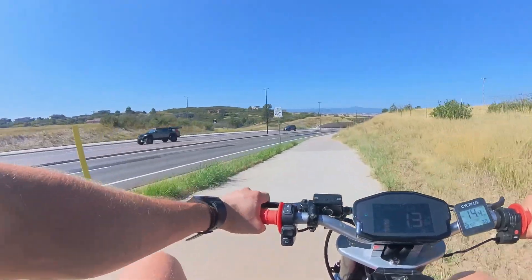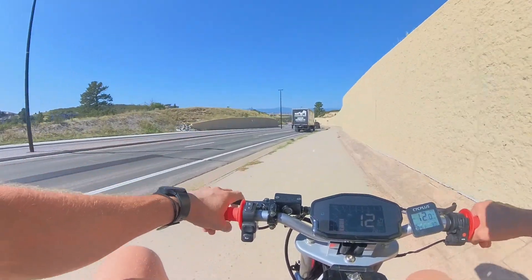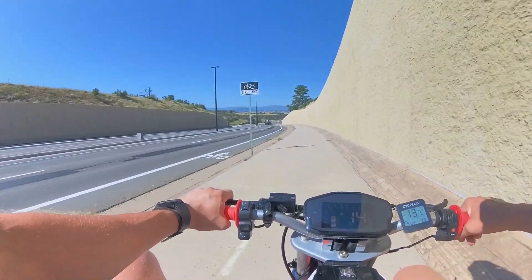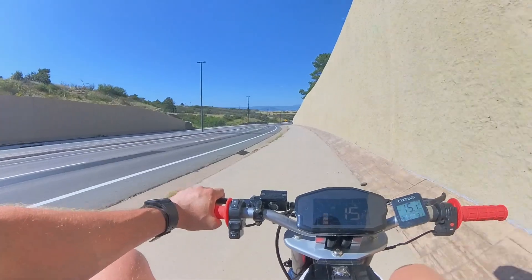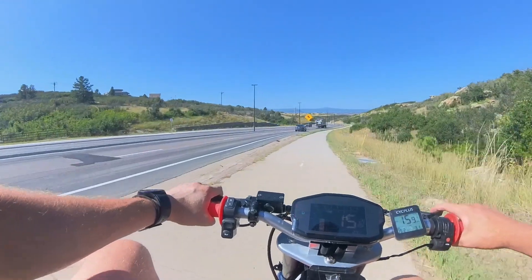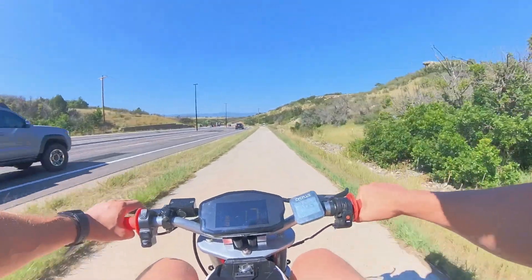That's a pretty good speed for this setup. I tuned it up to 150 line amps and 390 phase amps to see if that got more out of it — it really didn't. I saw 60 mph the other day with 130 line amps and 350 phase amps, so I'm going to bump it back down to that. It's just some extra power; I wanted to see how it felt on takeoff and make sure I hit top speed in the stretch. No issue getting to 60 mph — pretty impressive numbers.